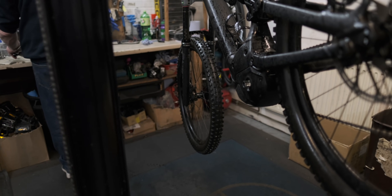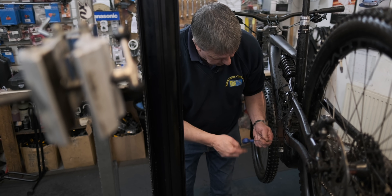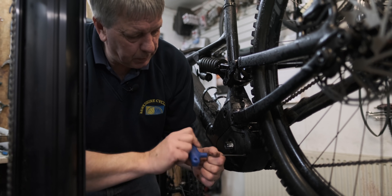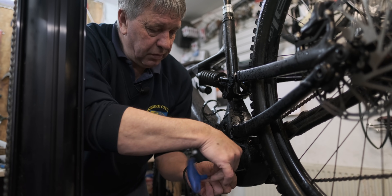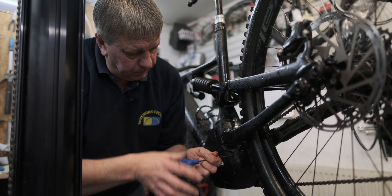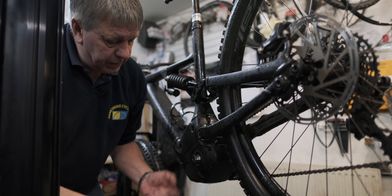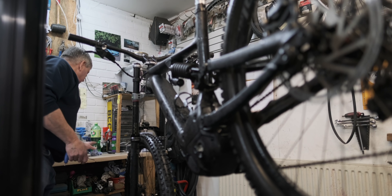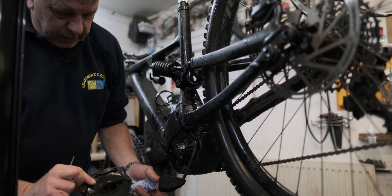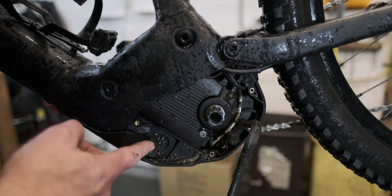Once you've removed the pedal arm, you need a 3mm allen key — there are four little 3mm allen key bolts here. People say to me this invalidates the warranty — it wouldn't. We've spoken to Specialized about it and they're happy for people to remove the cover and keep things clean. Do you think they should put this kind of stuff in user manuals? A lot of people would like to do it but just don't know how or that they need to. Yeah, a little maintenance video would definitely help. You can see now Rob that water has got in here — all around the battery terminal we've gone past the seals.